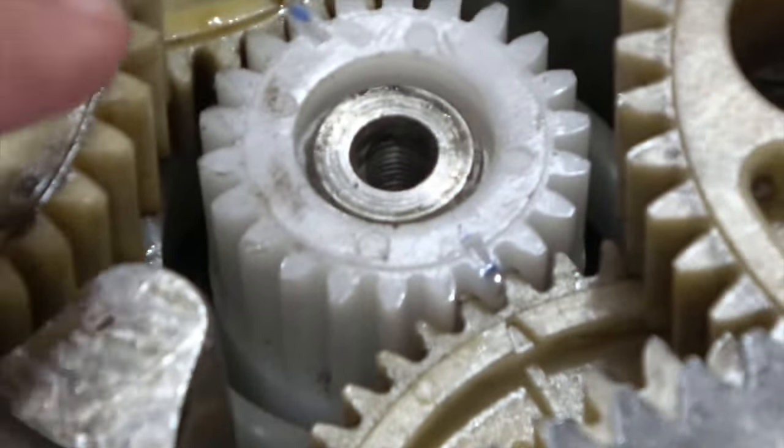These armatures line up here as they go back and forth and brush. So I'm gonna want the oil level to be at least that high when I fill it all up. So with that, I'm going to use a left-handed screw and tighten down this pulley that was replaced. And again, the reason this failed is after so many years, that pulley wore out.